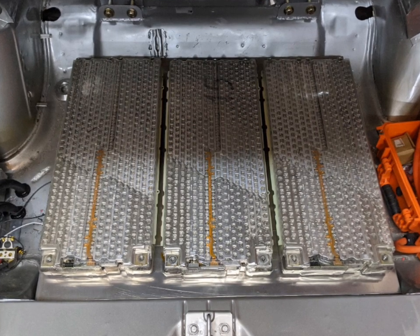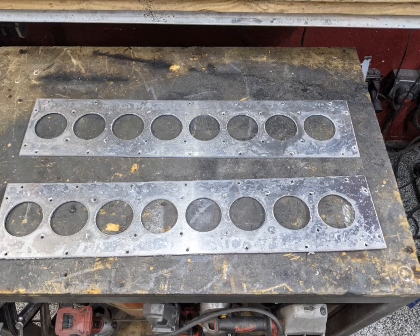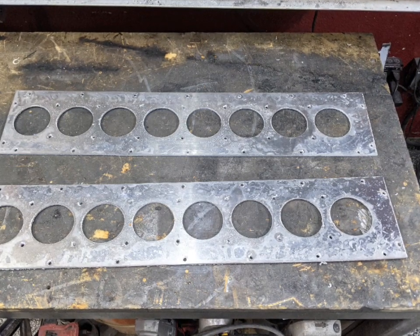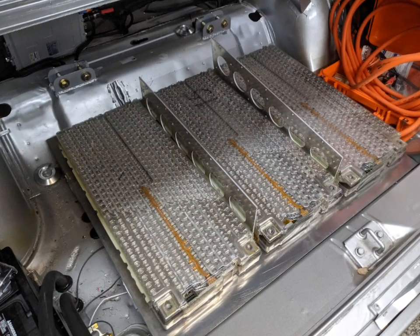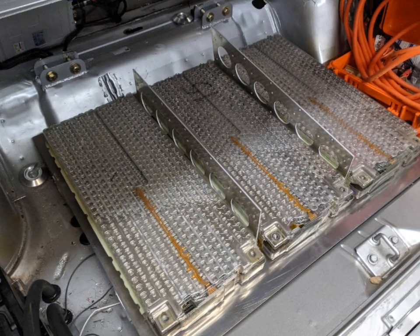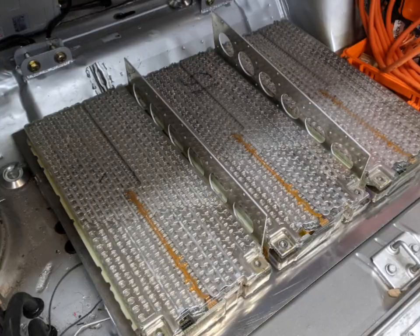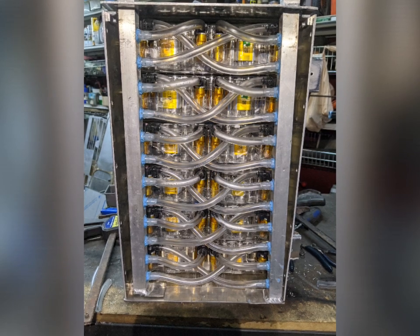There's plenty of room to fit three modules side by side, so I'll have two stacks of three — 2 by 2 by 2. Because this is in the trunk, I can hole-cut the sides and supports since it doesn't need to be waterproof, saving a little weight. I started with the three modules in the bottom, and since they would be too high, they'll have rails to support them all. The center supports allow an angled ½-inch aluminum riveted in, so I can bolt down the modules to those rails for support in all directions — front to back, side to side — so they'll be very secure. The tricky part was the plumbing.